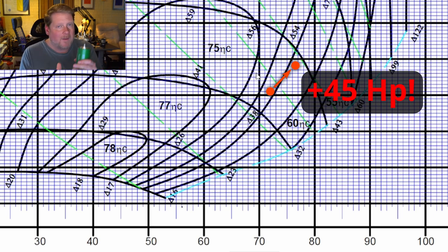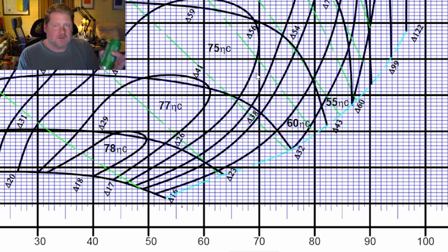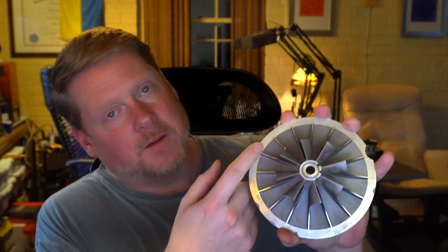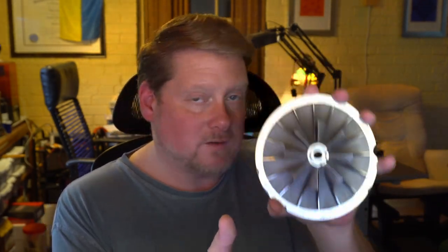But we'll need to play with the timing first and see if we can get that 675 to 700 amp current draw down a little, since the ESC has a continuous rating of 800 amps. Then the big option is to simply switch over to a different compressor. This is the original impeller — an SC trim — and you can see the fins are milled down and clipped. That was designed for mod motors that spin at high RPM so the blower survives, but it's exactly the opposite of what we want, which is why I went to an SI trim unit.